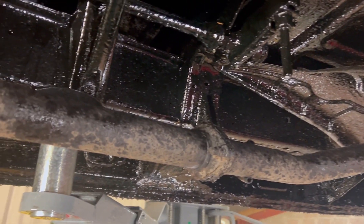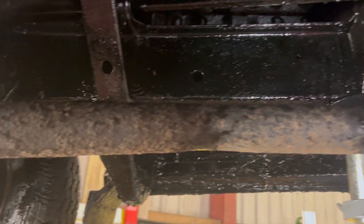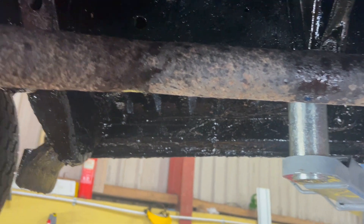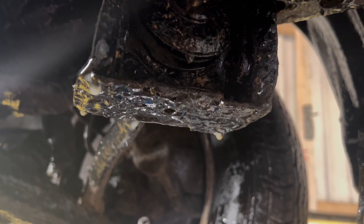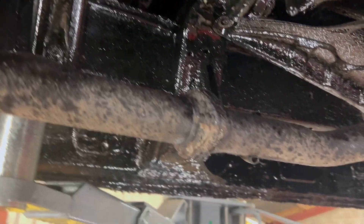The van is done already, and you can see here I cleaned it and then just spray it on. Prep-wise, it's just a case of taking off the loose stuff and spray it on. Keep it away from your exhaust — it's not a massive deal if it goes on there, however it's going to smell — and keep it away from your discs. You can see here it's starting to solidify a little bit, so that's what it dries as. It dries waxy and oily. It will attract dirt, so if you're going to stick it on your 2023 Maserati you're going to wonder why your arches are stinking. It wipes off dead easy — you can hit it with the steam washer or with a cloth and it'll come off.